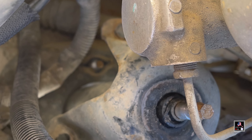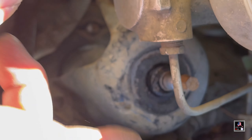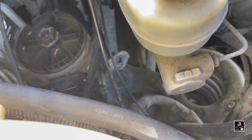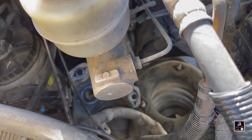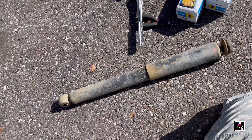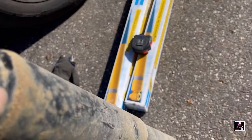The front shocks are definitely in better shape than the rear — you can see it pushed straight up. Take the shock tower and get it out. You can take it all the way out, but I don't think there's really any point since I'm going to put the new one right back in. To get the shock out, just push it down to compress it, then pull forward — it comes out pretty easily after you compress it. Here's the old one; I'm not sure if we'll need the hardware because I haven't opened the new one yet.